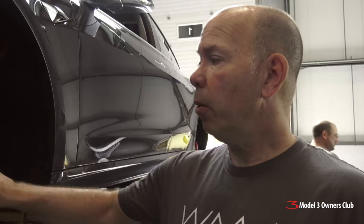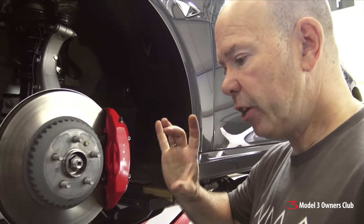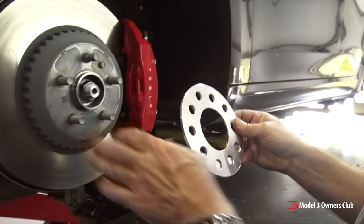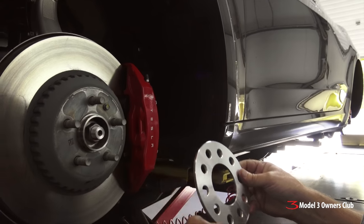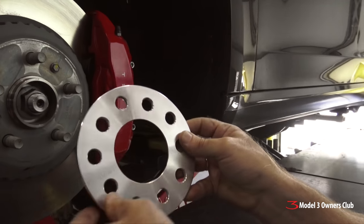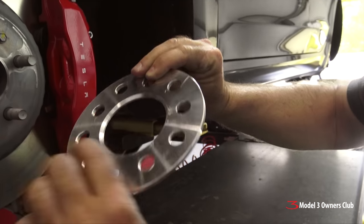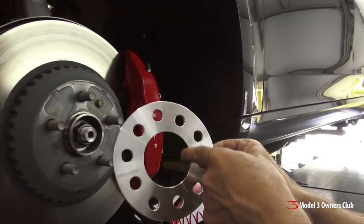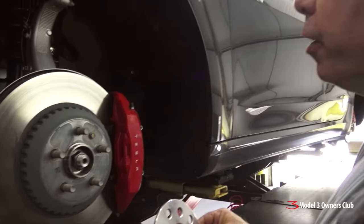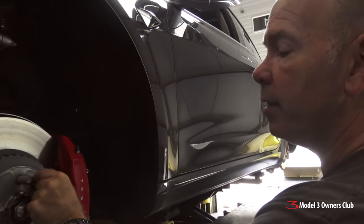The hub step poses a problem: if we try to fit our wheel on there without that chamfered ring or relief in the back, most wheels won't work. Option one is to put a thin spacer. The step is about 69.5 millimeters, so you need a spacer with at least a 69.6mm center hole. We're using a dual bolt pattern forged aluminum spacer — custom machined in our three-axis CNC to precisely 69.6 millimeters, a perfect match for the hub.